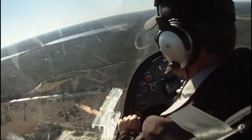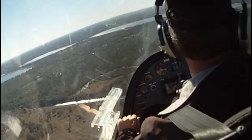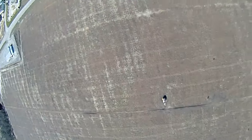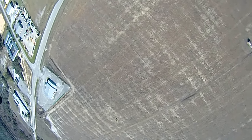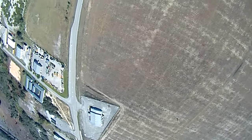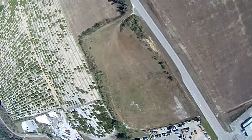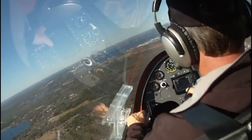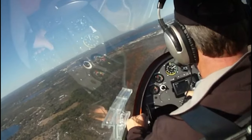When you pull back on the stick — and you do this gently — let's take a banked turn as an example. In a fixed-wing aircraft you begin to feel G-loading because you've got less wing area lifting you. In the rotor aircraft, as you pull back on the stick a little bit, the rotor speeds up. I likened it to a smart rotor — it kind of knows what it needs to do in order to keep producing lift. Instead of increasing angle of attack as you go around in a circle like a fixed wing, the rotor speeds up.